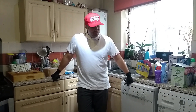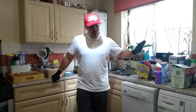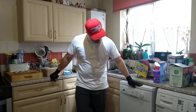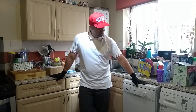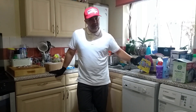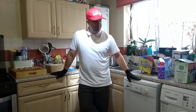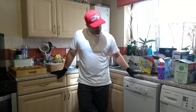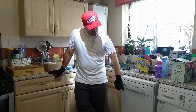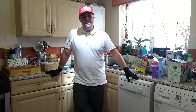Welcome to this video showing how to sort out your slimline dishwasher that probably has a flow-through heater that is not functioning correctly. Symptoms include dishes coming out reasonably clean but not totally clean, anything with grease coming out very greasy, and no heat emitting from the side or front of the dishwasher — which probably means there's a problem with the heating system.